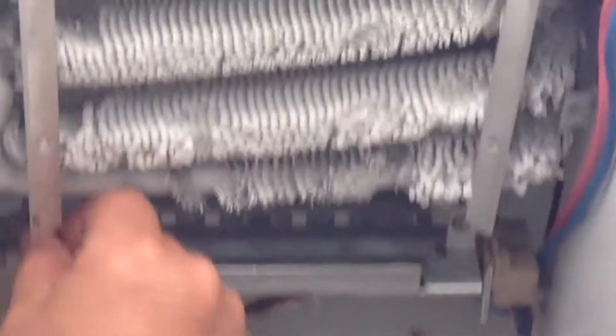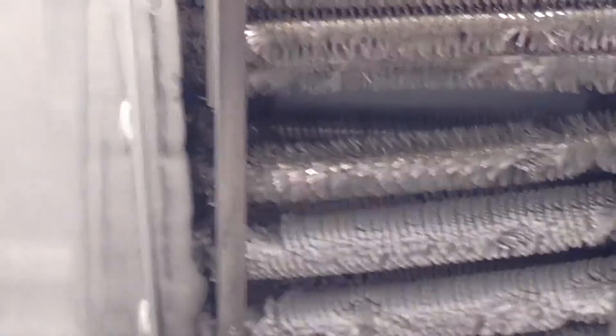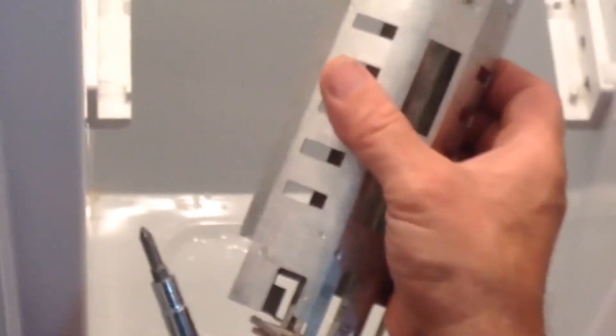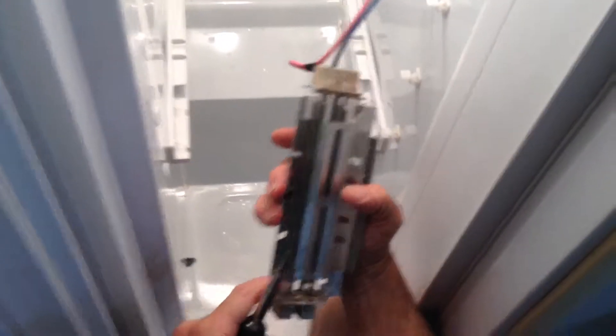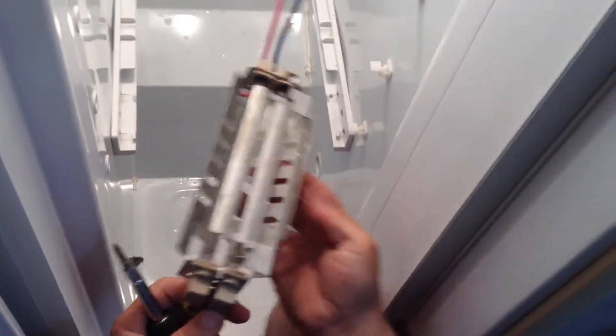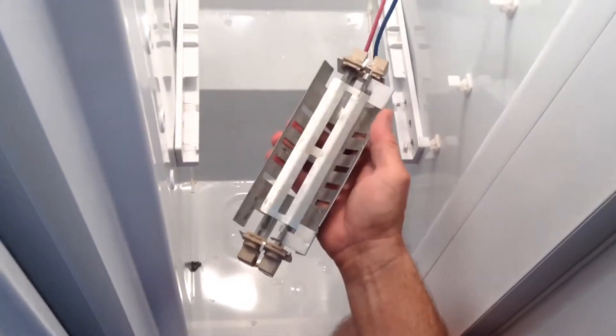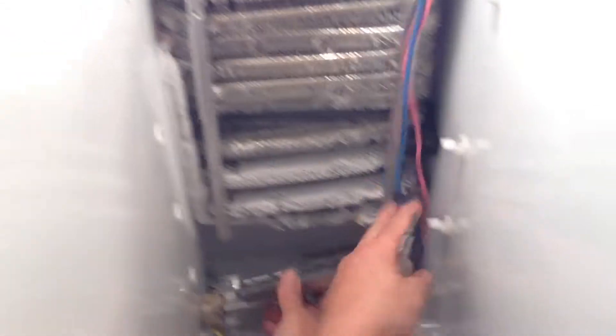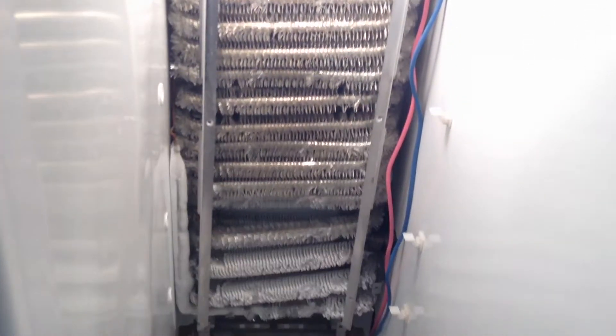Yep, this is your heating element — just two simple screws. So that's your two heating elements. The two little sensors on the end of the elements may have gone bad. In any case, it's probably best to replace this as well as the temperature control, just to make sure. From my understanding, the temperature control is about 10 bucks and the heating elements will probably be about 40 bucks to replace.